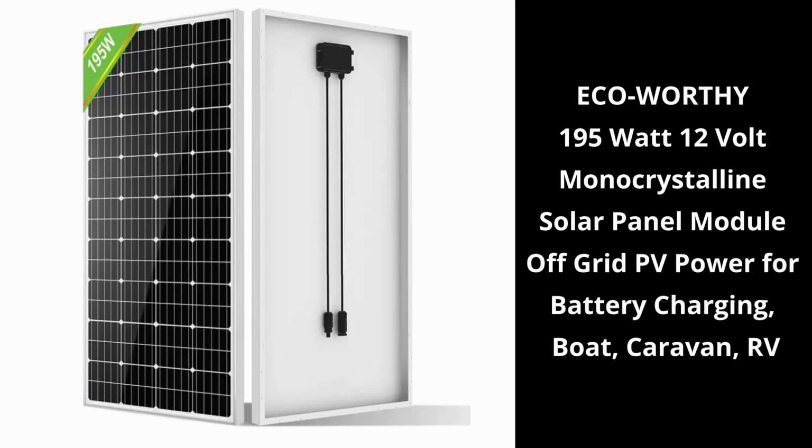This is the solar panel we purchased from Amazon. It's 195 watt, and the reason we went with that is this RV is already pre-wired for a solar panel when we bought it. But we did a little research, and the maximum wattage you can put through those wires is 200 watts. So we went with this 195 watt solar panel from EcoWorthy. We'll put the links below to all the products that we bought to do this job.